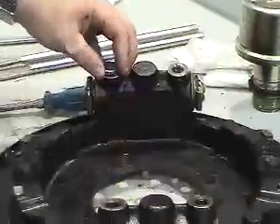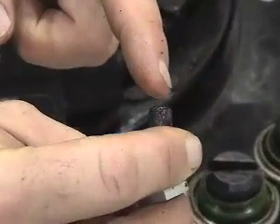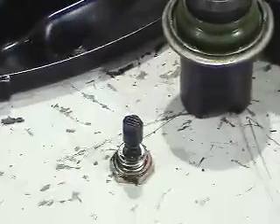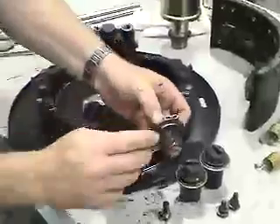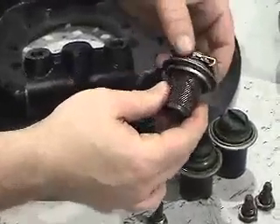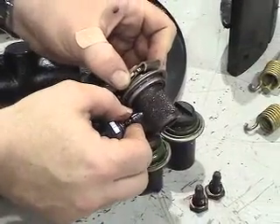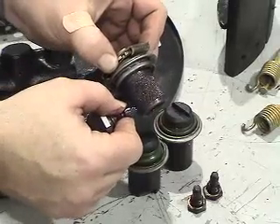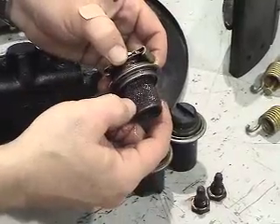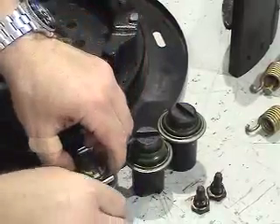The adjusters use a pawl system. These pawl teeth will ratchet in one direction and lock in the other — the design allows them to ratchet one way but lock in the other. The adjuster is threaded into the top of the adjuster plunger. As this pawl goes over top, as the plunger moves out and the shoes move out to brake, it will ratchet over in one direction. But as it returns, it locks and causes the whole assembly to rotate — a very small amount each time, but enough to keep the shoes close to the drums and adjust properly.